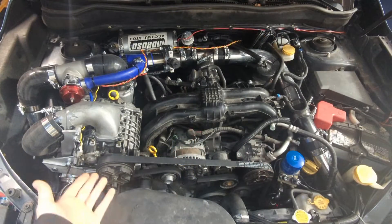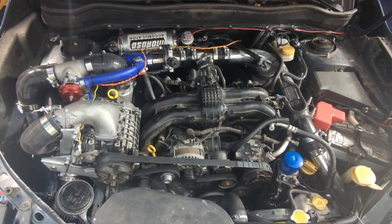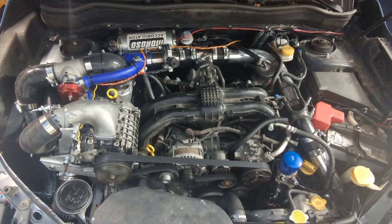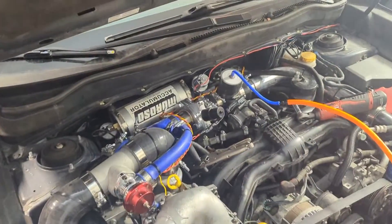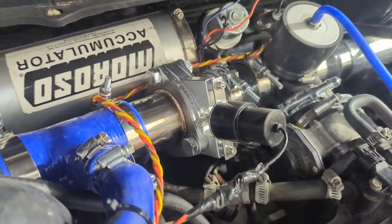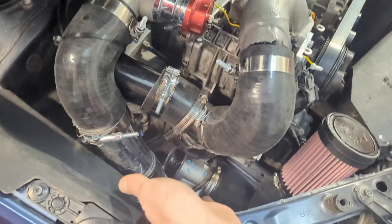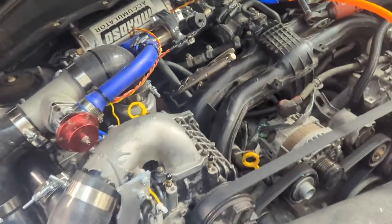For the first start I'm gonna shoot from the engine bay. Back to my favorite pastime of smoke testing. The reason we're doing the smoke test is because the car is sputtering during initial startup. Revving it, it does continue to idle but the fuel trim just shoots right up to 30-40%. Essentially it means there's more air entering the engine than the mass airflow sensor is recording.